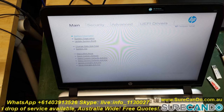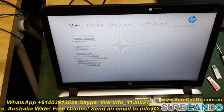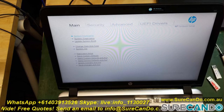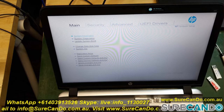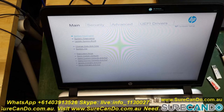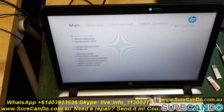You actually need to clear the secure boot keys in order to disable secure boot. If you don't, you will never be able to boot in legacy mode. Legacy is CSM boot — if you've got a USB formatted in that way. It was a bit tricky to find out.